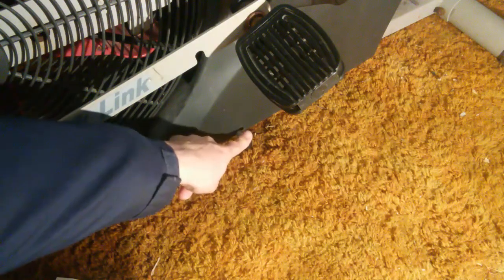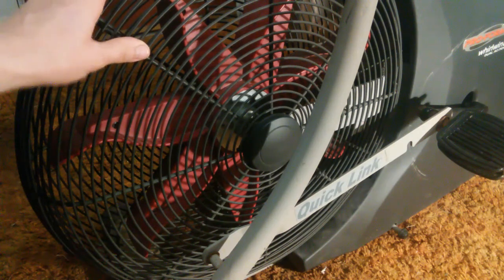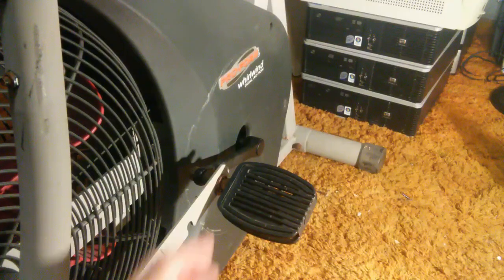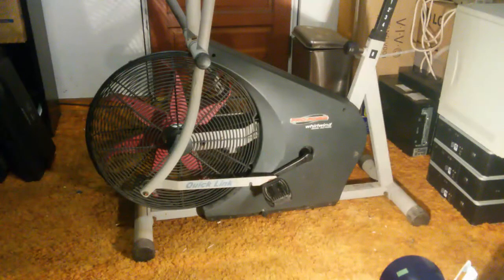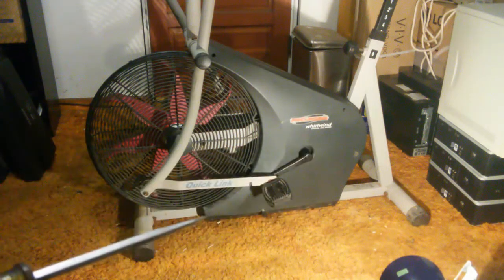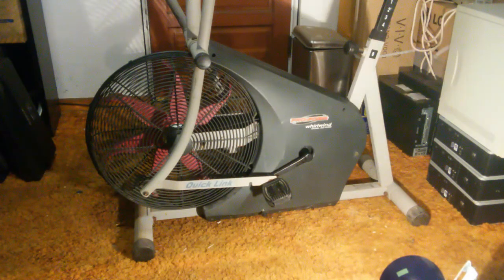I think the lock rod is probably the best place to start. The next thing I would remove are the fan covers — the screens that protect you from the blades. Then I would remove the crank handles, and you're going to need a crank removal tool to get these off. The side covers are held on by five Phillips head screws, located around the cover. When those screws are removed, the side covers can just be pulled away, exposing the bottom bracket and the bearing inside of it.